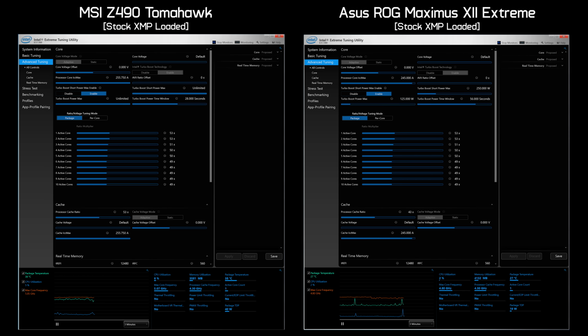Far Cry New Dawn highlights a worst-case scenario for Ryzen, and here the 10900K is 18% faster than the 3900X, which is quite a significant margin, and 134fps on average as opposed to 114fps will be more desirable for high refresh rate gamers. That margin remains pretty much the same at 1440p, as even here we're still mostly CPU bound, and as a result the 10900K was still 16% faster than the 3900X.